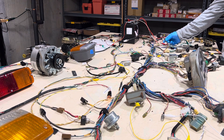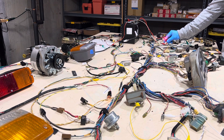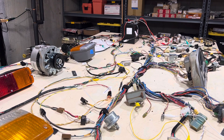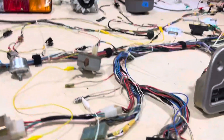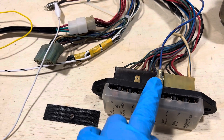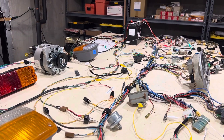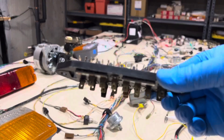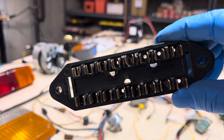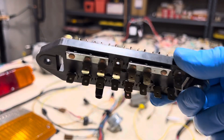On this particular customer's harness, they're installing an EFI, so I routed a blue and red wire near the glove box for where that sub-harness will live, and the key-on circuit is right here on the actual fuse block, in this position here. While we're talking about the fuse block, I recommend when you're doing a harness to make sure that you clean very well all of the fuse terminals on the block — both sides.